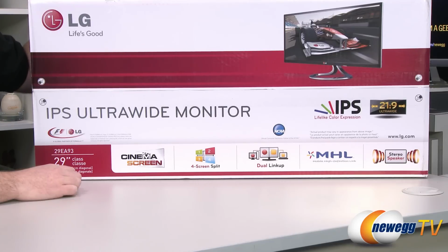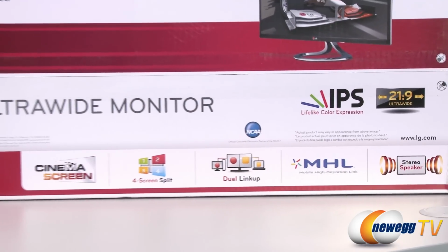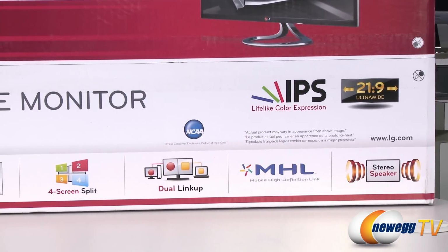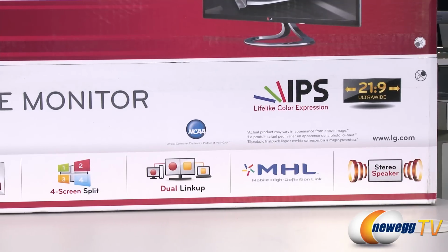And it also gives you some workspace productivity options in that you can easily display two 1280 images or web pages side by side. It's also an IPS monitor. That stands for in-plane switching. It's the technology in the LCD, and essentially it's going to give you greater color depth as well as better color reproduction and also a wider viewing angle. Also includes stereo speakers that are integrated.